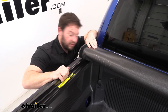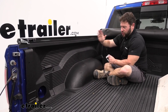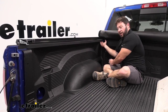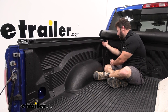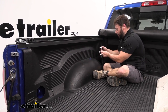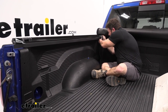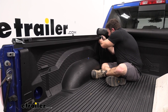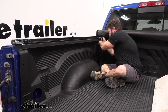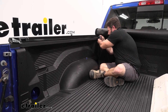Bring the tonneau up so you can push the rail forward a little bit more, then go to the front of the bed and install the first clamp. There are three clamps you'll evenly spread out on the side rails — put the front clamp as close to the front as you can. Check underneath the rails to make sure there's nothing in the way. You'll need to disassemble the clamps to set them into place, then line up the bolt to the hole and hand-tighten just to keep it in place, since you'll still need to adjust once all three clamps are in.